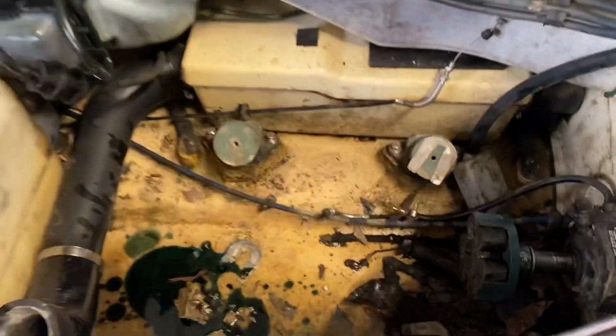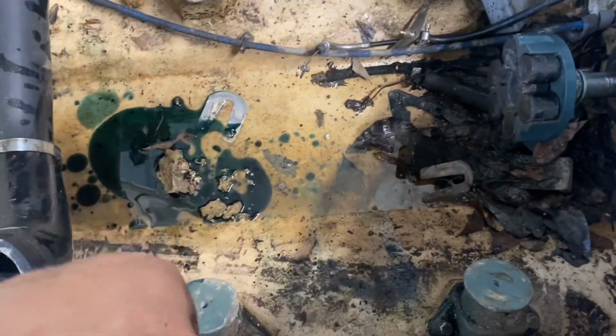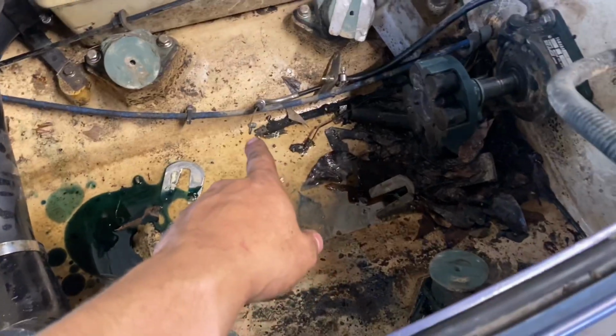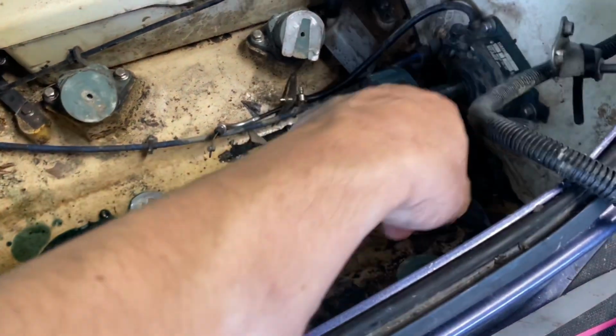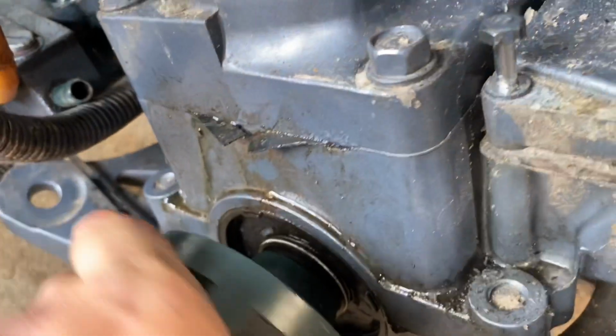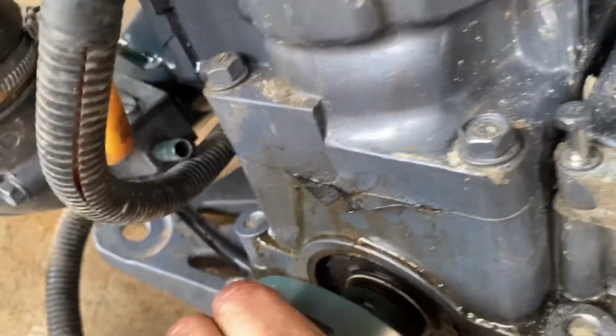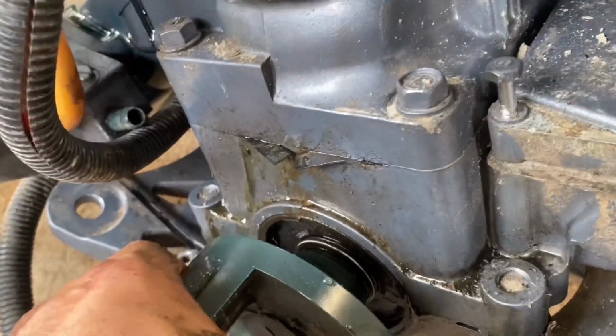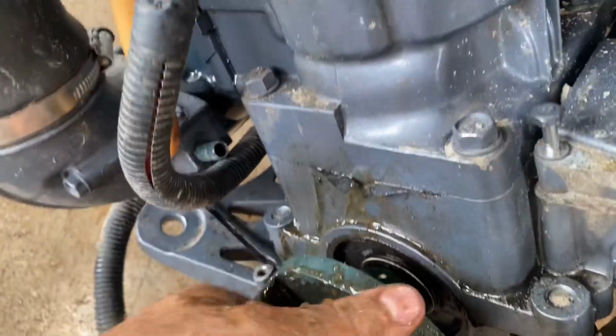All right, got her out. Just make sure you put your shims back to the right sides. Oil line's disconnected, fuel line disconnected. Ground wire to the starter, choke, and the grease zerk for the output throttle cable. Everything else comes with it. This is what I was talking about. That was blown out. But the cylinders are fine. It's weird.